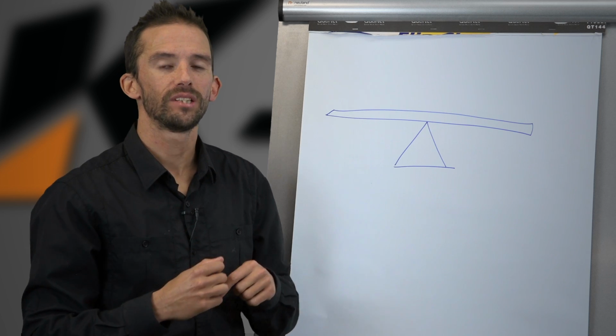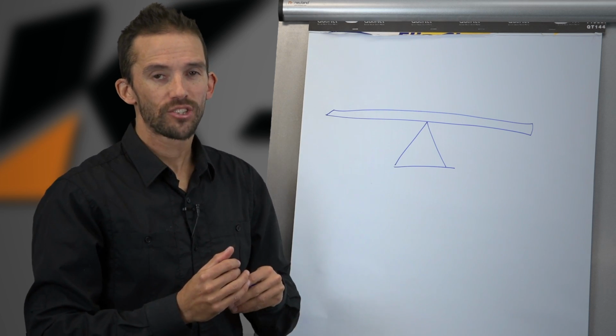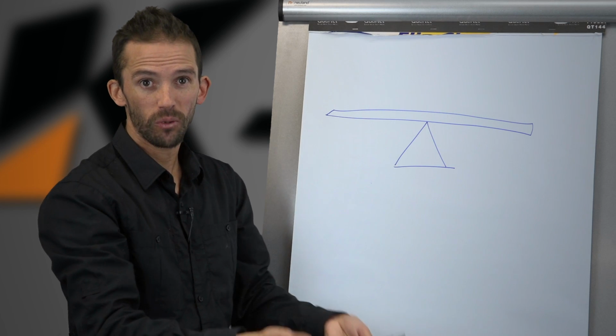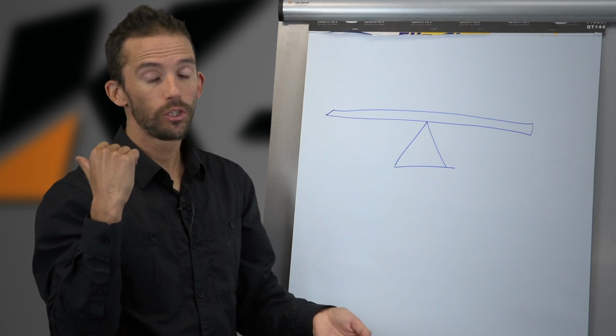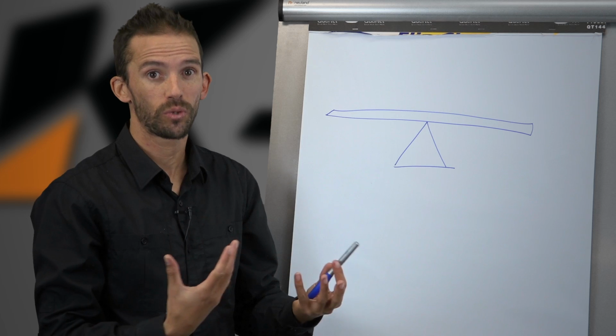The first question is, which end slips first? Which end am I losing? So if you come in and you're mid-corner and the front starts to slide away, then obviously we're working on trying to work out how to get the front tyres to hang on. Maybe you lose the back first, but is the kart understeering or is it oversteering? That's the first question to ask.